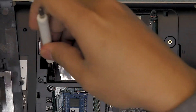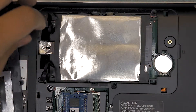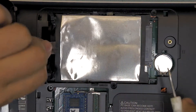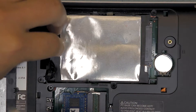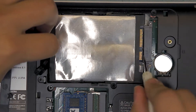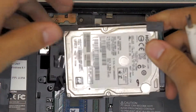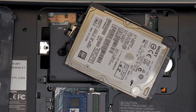Remove this one up, and remove the other side — just pull it up. Once you have these two, you can lift up this aluminum foil and pull it towards the DVD ROM. And you're going to see the hard drive separates from the connectors. Then you can go ahead and lift up the hard drive. And that's your hard drive if you want to replace it.